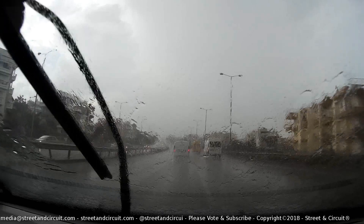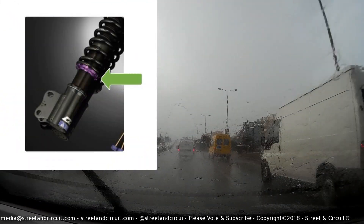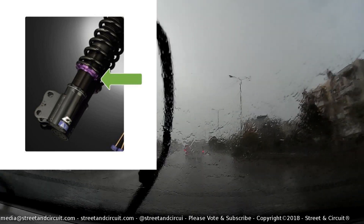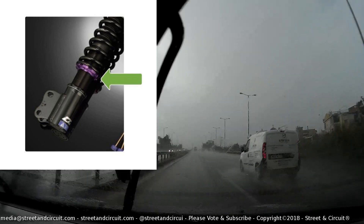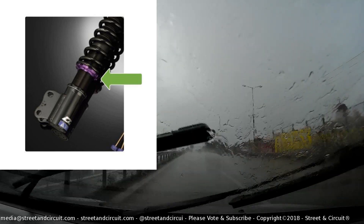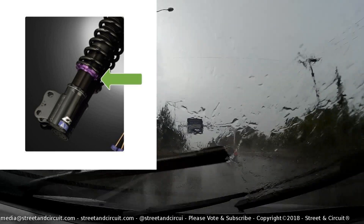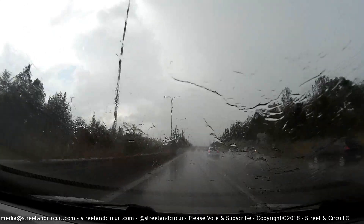Let me come on to spring preload. It depends on the coilover that you've got — it may be unavoidable that you have to put some preload into the springs if you want to adjust the ride height on your car, simply because the ride height is adjusted according to the bottom out on the spring seat. Personally I don't like that type of suspension system, because you're altering the spring preload according to the ride height.